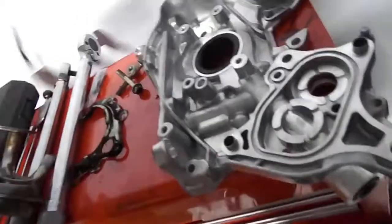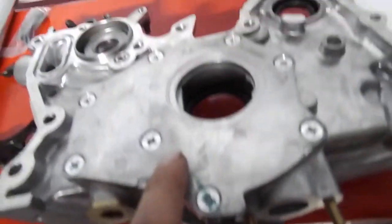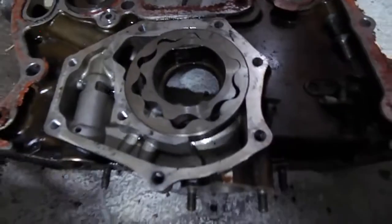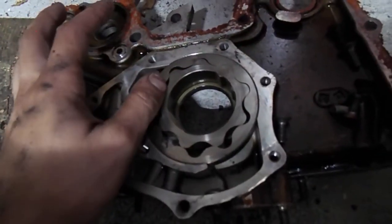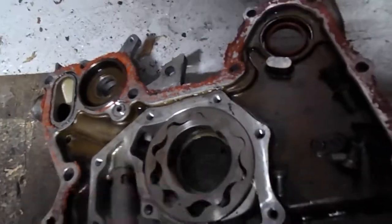On these oil pumps, a number of things can fail. This is the back side of the oil pump. Inside here there is an actual gear — it spins — and that gear itself can shatter. This is your oil pump gear; this is the same oil pump with the cover removed. This gear itself can shatter and cause a loss in oil pressure. A lot of B-series guys complain of this — if you rev your car super high on a regular basis, these gears go bad. Especially if there's no balance shaft, hard motor mounts, with all the vibrations at high RPM, can cause these to shatter.